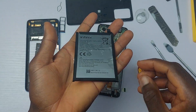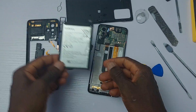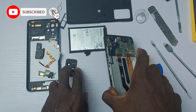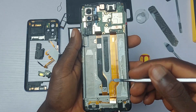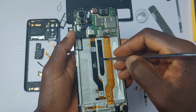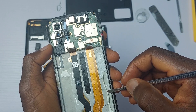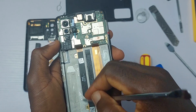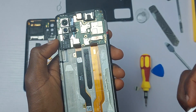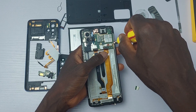As the phone comes with a Mediatek Helio G95 chipset, I'm more concerned about the heat management and cooling system for the battery itself. When playing games, most phones tend to get very hot — not warm, but hot. There is a difference between a device being hot and being warm. Below the battery is a graphite tape. Smartphone companies have been using two types of heat-conducting materials: graphite and copper. Copper is the better heat conductor, but graphite is not bad either. So having a graphite layer beneath the battery is okay.